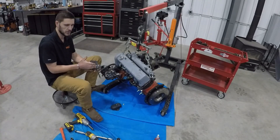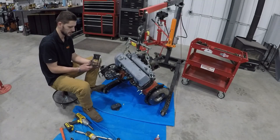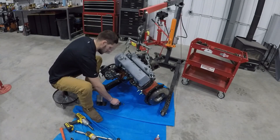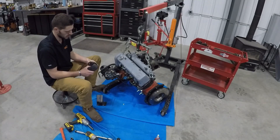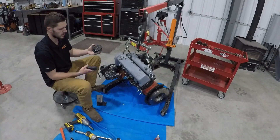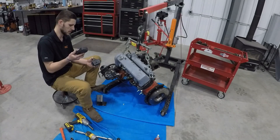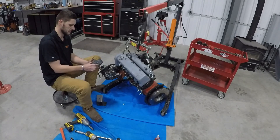When you order a set of motor mounts from Doomsday Diesel, this is what you get in the mail — just a welded steel bracket. If you're wondering how this attaches to the frame rail, it's simple. You use a factory Toyota rubber isolator — that's this guy here. They're about $10 on Rock Auto. This steel plate should be with your truck; if it's not, you'll have to go to Toyota and order a new one — they're about $22. This just slides over top, like so.